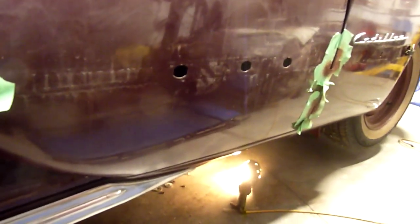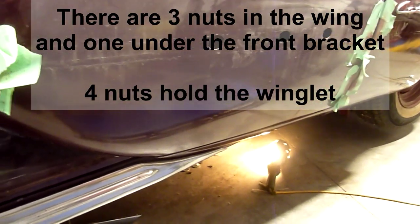The hood's a little lighter, although you'd never know it. There are three more bolts each side underneath the wing that will limit travel. There's a little winglet that bolts to the body and also bolts to the fender here, so if it's rubbing up against the body mount — which this one is — that will stop it from going back as well. It's an inflexible joint. I'll take this wing off so I can adjust in here to get more room for the fender to come back.